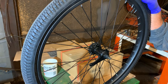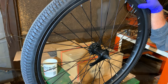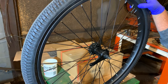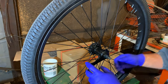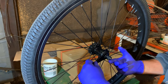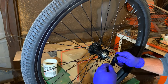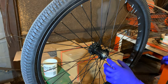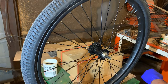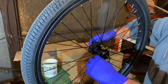Hopefully that gave you at least a common knowledge explanation of how your rear coaster brakes work — I know it wasn't the most scientific thing you're going to hear, but hopefully it got the job done. So anyway, moving on: we're going to remove our brake arm, set that to the side, and we're going to remove our bearing cap slash dust cover to expose our bearing. Then we'll use our brake arm to loosen our bearings and race.